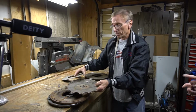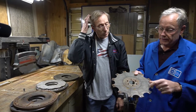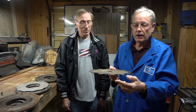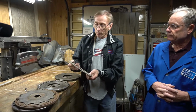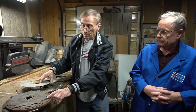And Ray, we'll note that the area where the plate bolts up to the crankshaft, you can see how thick it is, but at the outer edge where the flywheel goes on, it's much thinner. Yeah, and then there's just an outer cover, so to speak, that stabilizes everything so that there wouldn't be stress fractures on these tiny little fingers from the rivets in there.